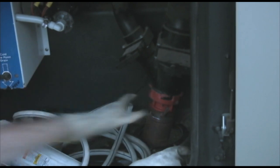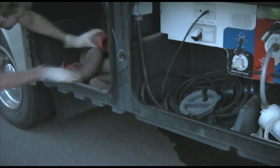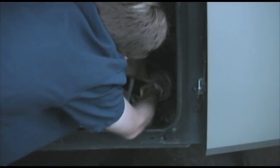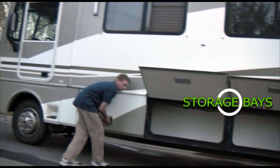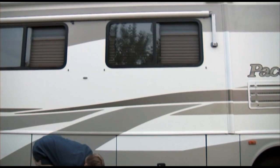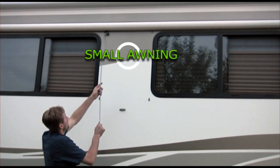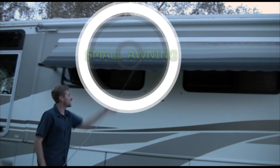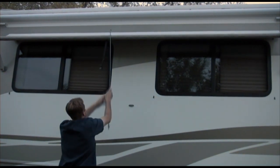That should sum up this area. When done, make sure these are closed, twist to unlock, pull down, and put the hose right back in its own bay. Screw the lid back on and you're good to go. The rest of this side is very easy — you have three bays for storage with plenty of room. Just be careful how much weight you put in here since this is where the main slide comes out. Right above these bays you'll notice there's a smaller awning for the slide windows. Just hook and pull the black strap and it comes down. When putting it back, use your hand to release pressure, twist it and keep the rod in the strap as it winds itself back up.